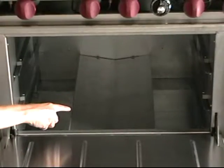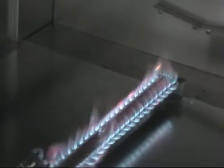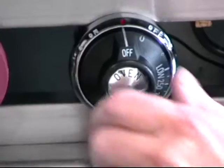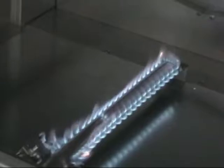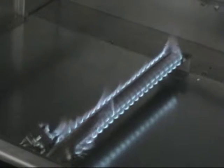See below the oven bottom — a flame spreader that evenly distributes the heated air into the cooking cavity. That hot air's temperature is controlled by a reliable modulating thermostat. It's called a modulating control because once the set temperature is reached, the thermostat modulates the burner flame to a low bead, maintaining temperature until called on to increase it.